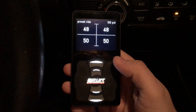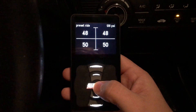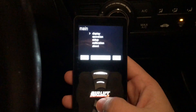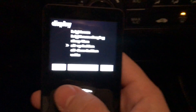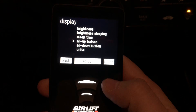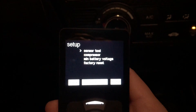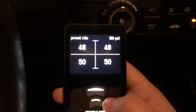Something I had trouble with at the beginning when I first got this controller is I had no idea how to go to the settings. What you're going to want to do is press the Air Lift button and the button right on top of it simultaneously. It's kind of hard to do with one hand, but press them both simultaneously and that will take you to the settings where you can adjust the display settings. You press the Air Lift button to select, or press the top right corner button to go back to home. You have your operation settings and other options to adjust the settings for your management system. To go back home, press that button and you're back.